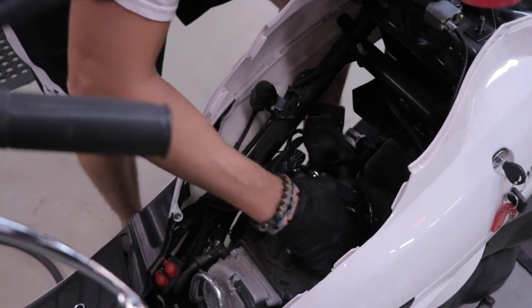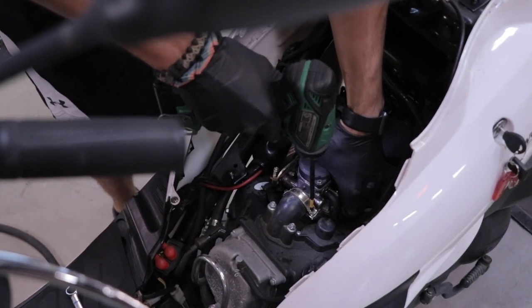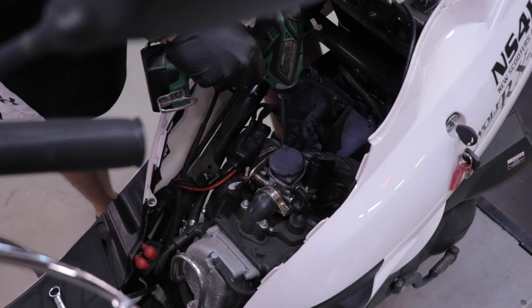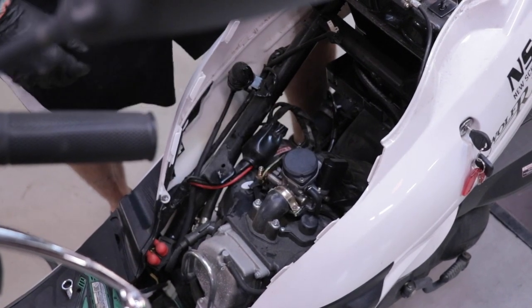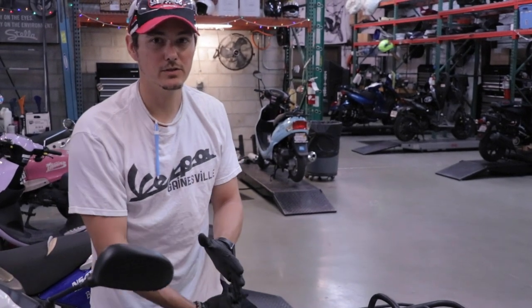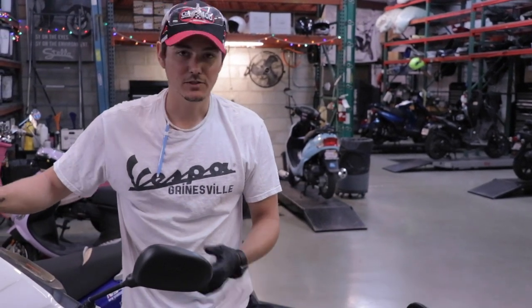Here's my choke — I'm going to route it to the other side just to get it out of my way. Creating openings and gaps inside the manifolds is going to create air getting in, and a lot of times too much air is going to stall out the scooter. So making sure these are nice and tight is one big mistake that happens a lot — even when someone says they tried replacing their carb and they come in. One of the things I see a lot is they just didn't get it tight, or they're getting the vacuum line pinched by either the carb itself or it's poorly routed, so it's constantly getting restricted airflow. Make sure the lines are not getting squished or pinched, especially when you go to put the seat back — that's why I like to route them underneath the carb or air box tube. Because as soon as you put that seat on and someone sits on it, that's 100, 150, maybe 200 pounds of pressure getting crushed there.